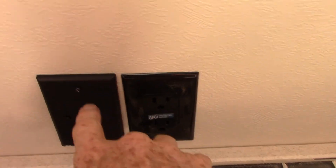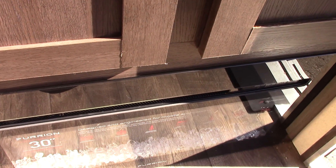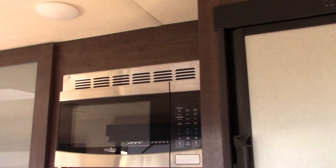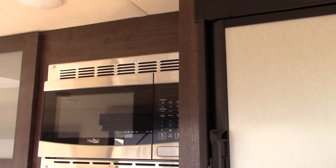There's a backer plate for a TV with hookups. This switch switches between the microwave and the fireplace — you can't run both at the same time. Right now it's set to run the space heater/fireplace, but if you switch it you can see the light come on, which sends power forward to the microwave.